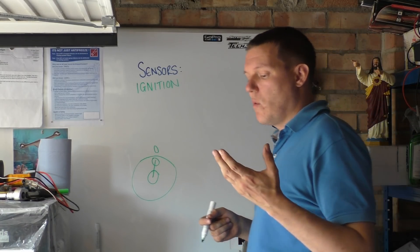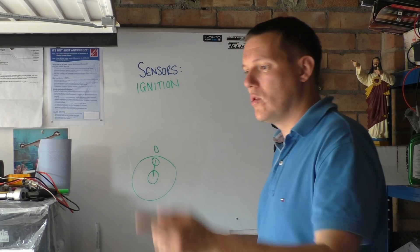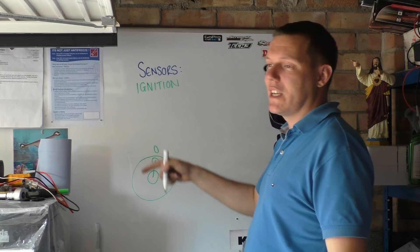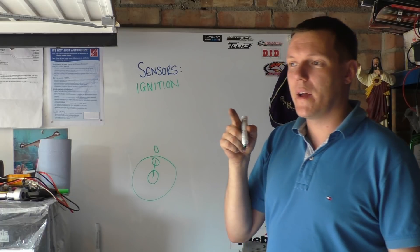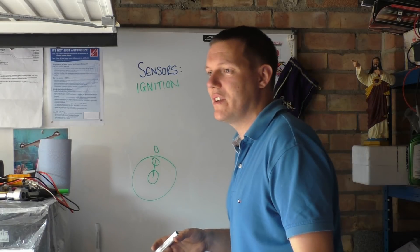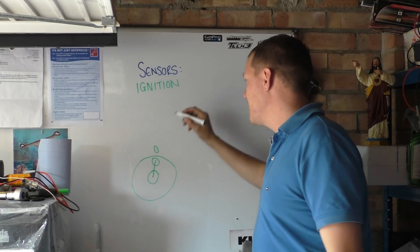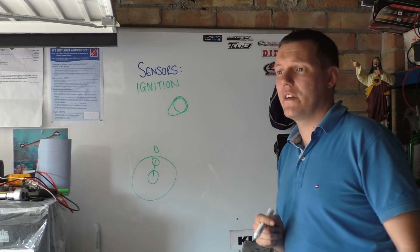The problem is you need to know which rotation this is because there are four strokes, which means there are four 180 degrees, which means there's 720 degrees of rotation — two complete full rotations. So if you just fired every time, you'd have a waste spark event. What you need to do is know where you are in 720 degrees. You can't put two sensors on the crank because then you'll just get a pulse every 180 degrees instead of once every 360. We want one pulse once every 720 to know exactly where we are. And there is one thing that turns at 720 — and it's our camshaft. Our camshafts spin at half engine speed.